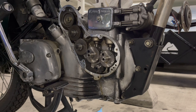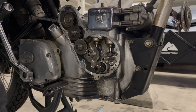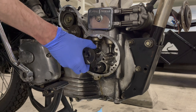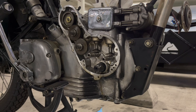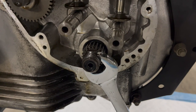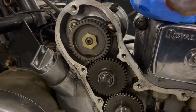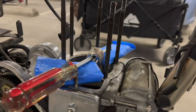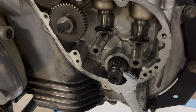The cam gear should just slide right out. This is really important: the worm gear has a left-hand thread, so you actually turn it to the right to loosen it. When you try to unscrew the worm gear, the crankshaft is just going to go up and down. Some people jam a screwdriver in to keep things from turning — I don't really like that, so I got creative and set up a little rig to keep the crankshaft from turning so I can unscrew the gear.